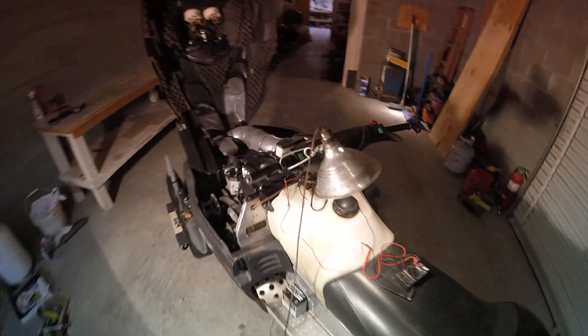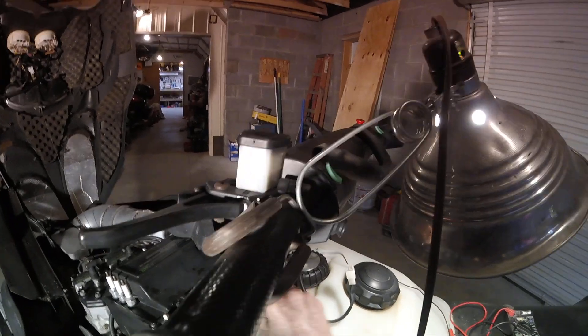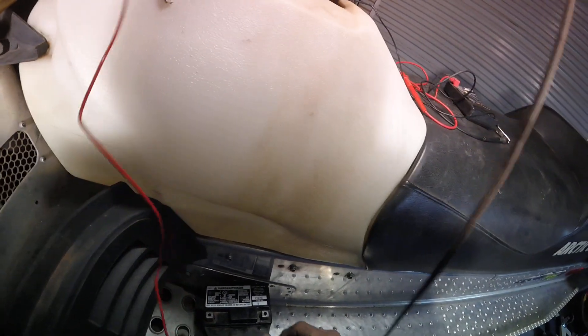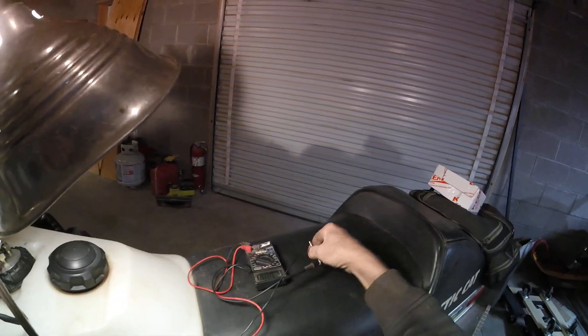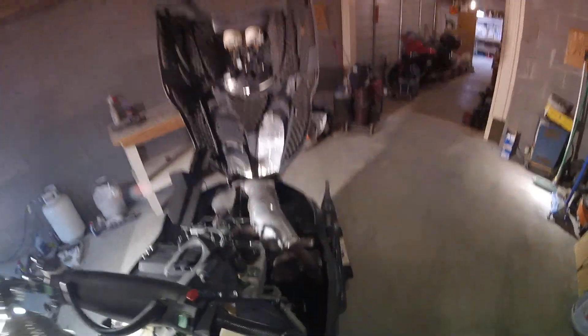My third test: I go and take my leads and jump right into the fuel pump - that's the red wire - then go right to the 12-volt battery. You can hear the fuel pump running, and it's actually flowing fuel. Then you run over here and the bike runs.